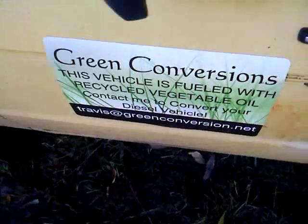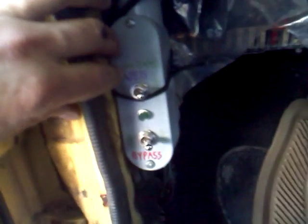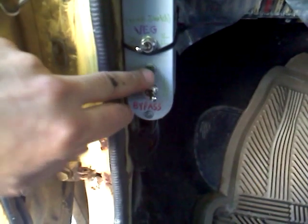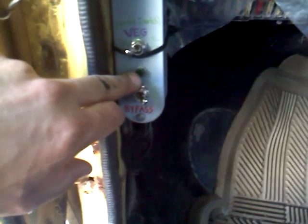The wires to control the valve come from here, and the wires for the temperature switch come from here. Then I go into the corner of my vehicle, down into there, and I've got my control box — just a simple box. I locate it down in here. The bypass turns on and energizes; turn it off. This one is the temperature switch — turn that on, the light doesn't come on, that means we don't have minimum temperature. So you just turn it on and drive, and when it hits temperature it automatically switches, the light comes on, and you're running on vegetable oil.